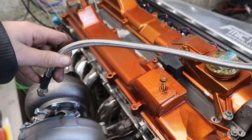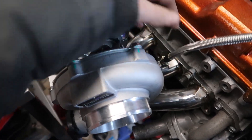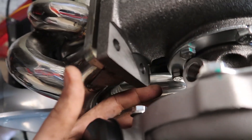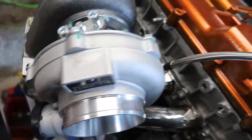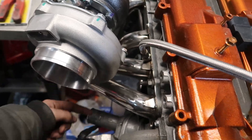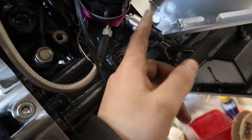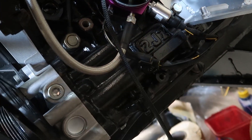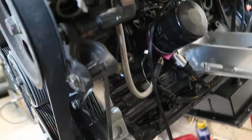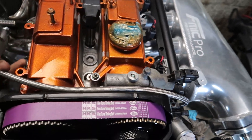I've just mocked up this one here and we've got the feed line here. I need to clock the core of the turbo so that it's about there, because then the return can come out this way and doesn't have to go through the manifold. I will be heat wrapping all of it as well — the piping — and then it just comes down here to our little sandwich plate, where we've got the sensors and then you've got the feed there running up nicely. I'll probably make some brackets for it, have it tucked down there out of the way, and then go into the turbo.